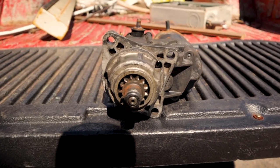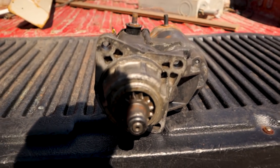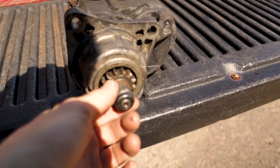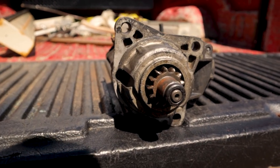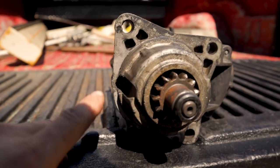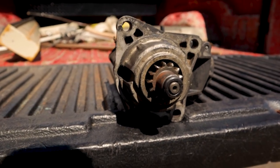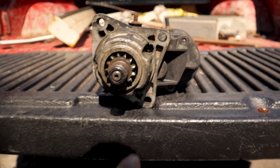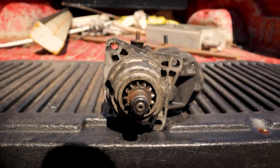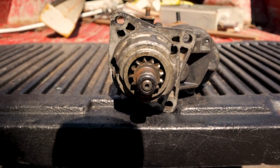Just to be a little more specific, I want to show you what screws those are on the starter. The three screws that I'm talking about are right here on the end of the starter, and what they would have done was allow me to separate that whole housing. Then I would have been able to gain access to this gear and clean everything up inside. This one screw right here is the problem — it's pretty well rounded off from whoever tried to rebuild this starter in the past, so I just didn't feel like it was worth trying to get out. I could have got the other two out no problem, but if I can't get that third one out, I'm not able to separate the housing and gain access to the gear.